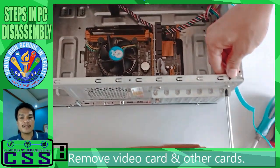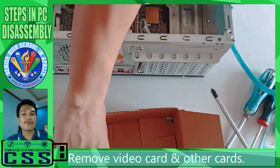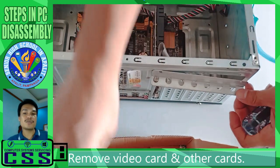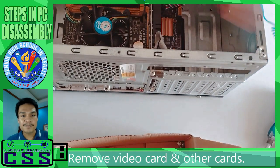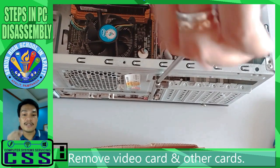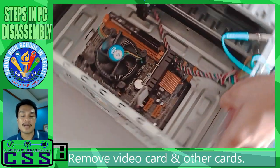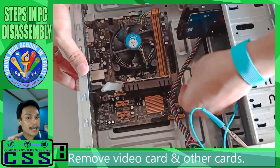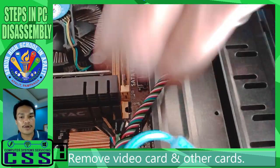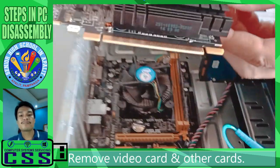After that, we can now remove the video card and other cards. In this case, we have one video card and no other daughter cards installed. It is properly secured with a screw. Again, unscrew it. Okay? Separate the screws. And then carefully remove the video card, or any other daughter cards you have. The video card has a lock, so we just unclip the lock and then carefully lift the video card from the system casing and the motherboard. Do not touch the golden pins of the video card.